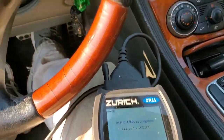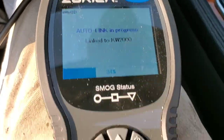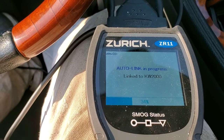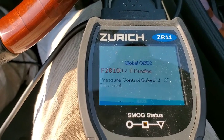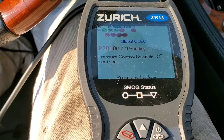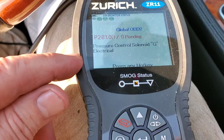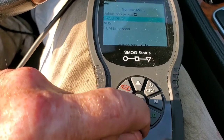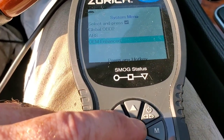I don't know if it's daily-driver better. Let's take it back to the house and put it on the scanner and see if it's thrown any new transmission codes. I've got the ignition all the way on without starting the engine and we're going to let it link up. Pressure control solenoid 2810G electrical — that's global — so let's go to the OEM enhanced and find out what our transmission reading is.